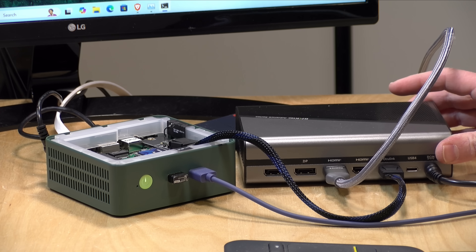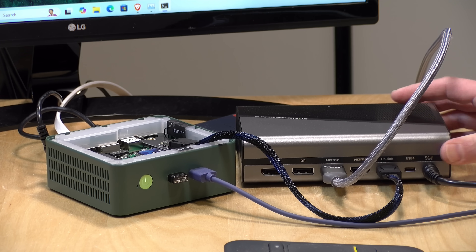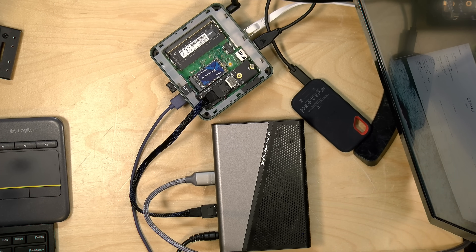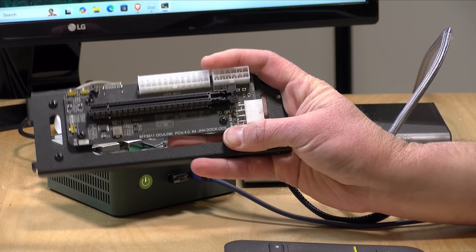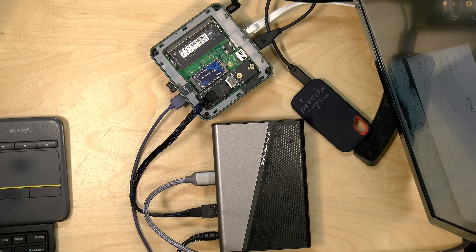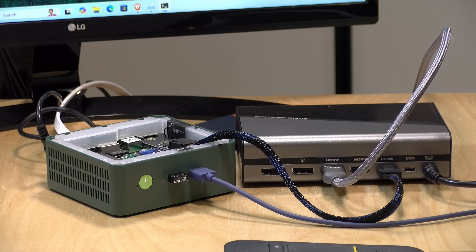Not the most practical solution, but it works — and it actually works much better than I expected. There wasn't a lot of hacking involved: just pull the hard drive out, put the adapter in, boot up, and it was plug and play. Once the drivers are installed, the GPU is simply on the PCI bus. Beyond graphics, you can hook up any PCIe card you have and get very good performance through Oculink because you're connecting directly to the bus. Fun experiment — hopefully this gave you some ideas for your own mini PCs. Until next time, this is Lon Seidman, thanks for watching.